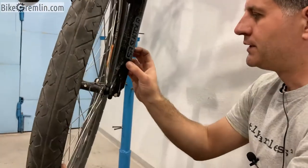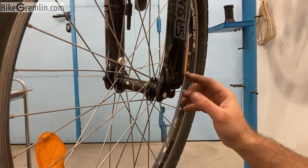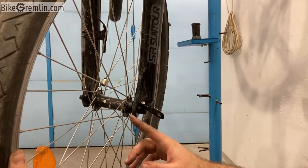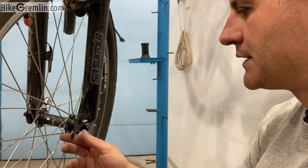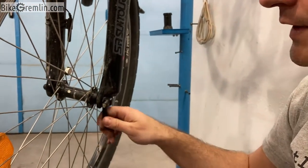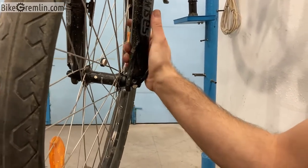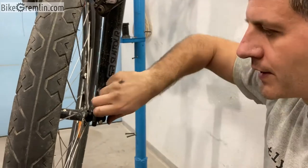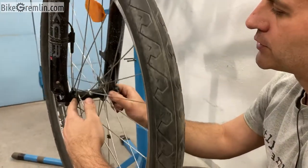With thick forks like mountain bikes have, I usually try to lock the lever vertically because I cannot lock it to go to the back. On road bicycles, I prefer to have it pointing to the rear side of the bicycle, because that way it will not get stuck on the wheel of another rider in front. It can happen when people ride in tight groups that if the lever faces forward, it catches onto a rear wheel and an accident happens. I'm not using too much leverage — you should be able to just close it with your hand. If you have to use extra leverage, you will have problems releasing it, and it will create too much tension on the skewer and too much preload on the bearings.